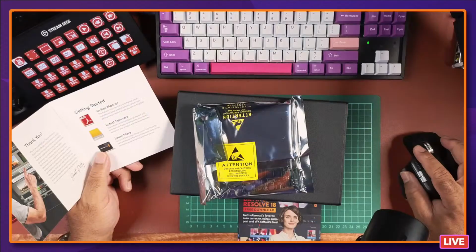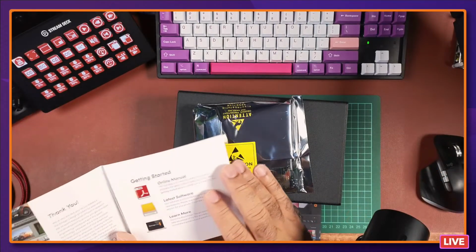You might even be able to chance 3 because you'll just plug in 2 Thunderbolt cables, in which case you would be accessing basically all 4 of the PCIe lanes. And what we're going to do, we only need 1 lane, right? So if you plug in the other cable, the box is probably smart enough to send it down the other lane. So there's that. Good question, Kevin, even though you did not put a Q. I knew your point. All right, it wasn't really a question. It was me helping you think this through.